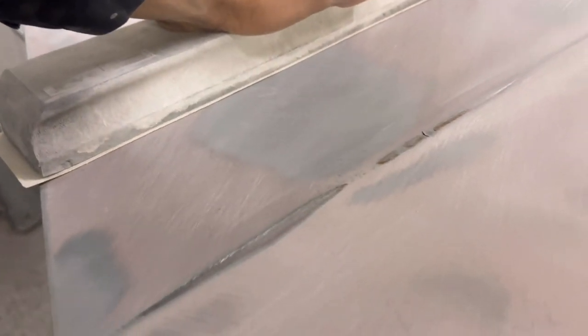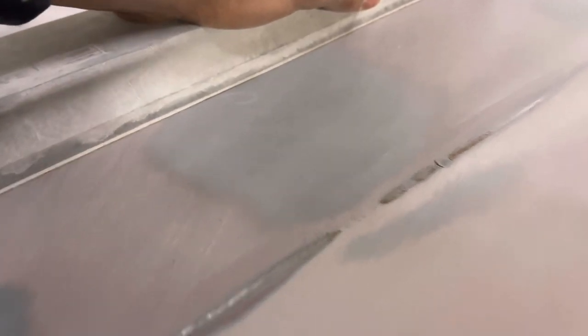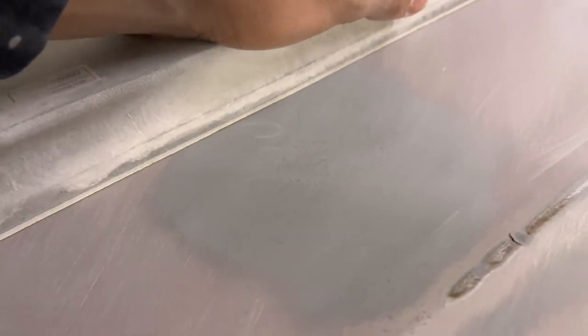So this is a block, clearly. Now the purpose of the block is this right here. So we got the paint right there. We got the guide coat. Now, if the guide coat stays there, that means it is definitely low. But if it goes away, if you sand it out, then you can block. Let's chase it. Enough talk.